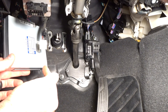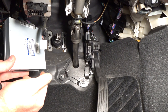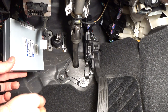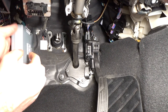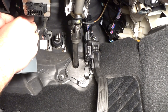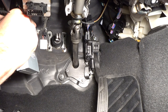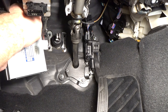Next we're going to install the clutch pedal assembly. This other module is the automatic transmission control module. When I first start this car up I'm going to leave it connected so I don't have to worry about any errors, and once we have it running I'll unplug it and see if there are any ill effects — I'd like to get this box out of the way. I may have to rewire some of the connector so it thinks it's in neutral, to avoid issues with turning the car on and hopefully keeping ABS functional, but we'll figure that out when we get to it.